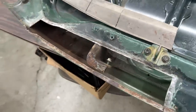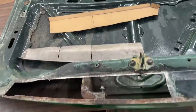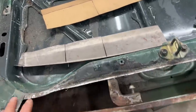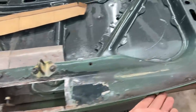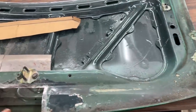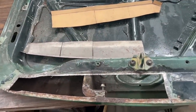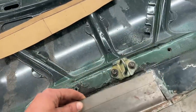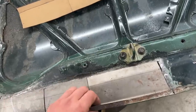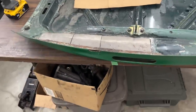Once this is welded we have to prepare this part here - we're gonna cut it out. We need to get rid of the body filler first to see what's there, because there's probably more. This whole entire area has been affected inside - we're gonna clean it up and see. Before we weld this we need to clean this up inside and see how far the damage is going, then paint and all that good stuff. I don't think we should repair that part before we weld this, because I don't want to distort the shape. Anyways, that's the plan, let's get crack-a-locking.